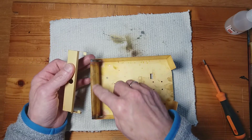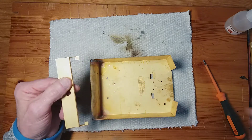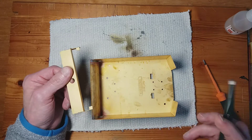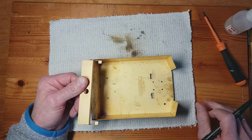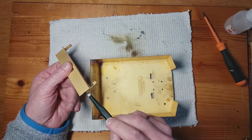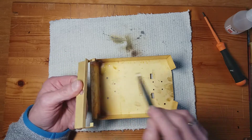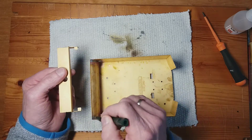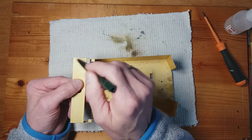I'll clean up the areas of the side where this is going to sit using the fiber brush, put it in place and secure it somehow. It's going to be in two phases really — I'm going to use solder paste to solder the tabs in place against the side, and then use flux to seal the rest of the plate.